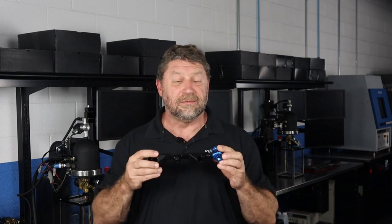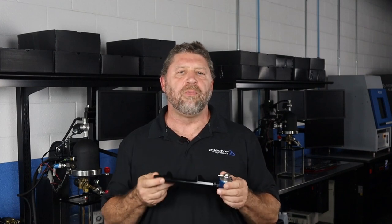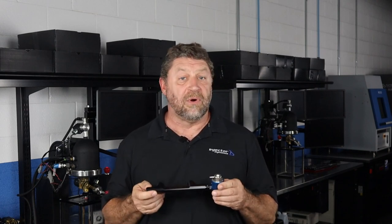And now you know why each one of these comes with one of these — well, one of the reasons. But as I mentioned at the beginning, there's one other reason: fuel pressure. What we just discussed is static fuel pressure. What we haven't discussed is dynamic fuel pressure, which is a measure of how much the fuel pressure fluctuates as the injectors open and close. As we delve into this in the next video, you'll be surprised to see how much it varies, how much it affects the way your vehicle runs, and how the effects can be lessened with proper fuel system design.